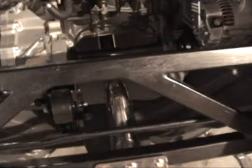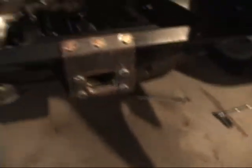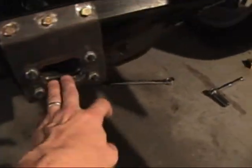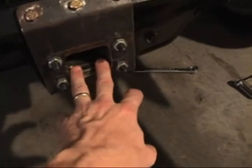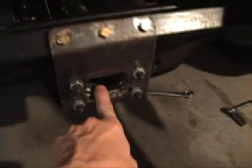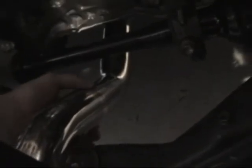Right here I've been working on the exhaust for the turbo system. I took the turbo off and I've got my T3 flange bolted here to my plate. I've got some two-and-a-half inch tubing that I ordered off the internet — they've got 45-degree bends. I've got one 45-degree bend tack welded together right here, and there's another 45-degree bend going in right there.